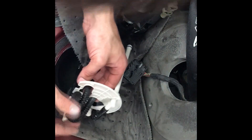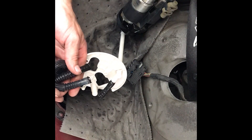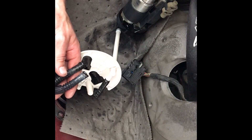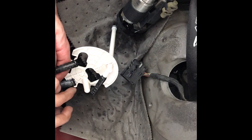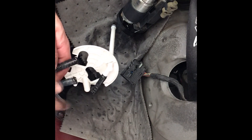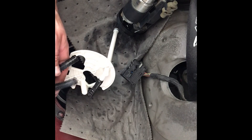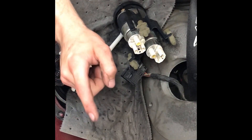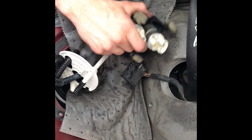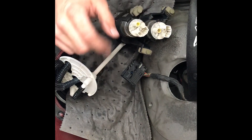The reason I try to get these off and reuse them is that most DIY fuel pump replacements have you use regular rubber fuel line, which would be fine except most fuel line is not rated to be submerged. The bottoms are a little messed up from prying, but up top we'll still be able to put a hose clamp around there — I'll warm them before I slide them on and that'll cause them to shrink around the new fuel pump. So we're ready to replace the fuel pumps, which I may cover in a separate video. Thanks for watching — please like and subscribe, and if we hit 500 by end of month I'll go to the dyno on full E85!